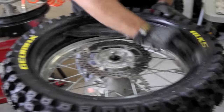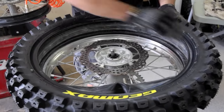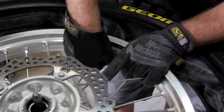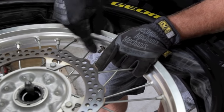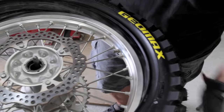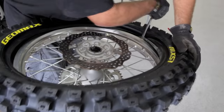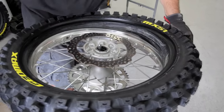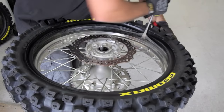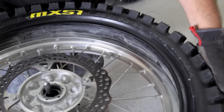We'll lube that thing really well all the way around. So we have our tube in here, now we're going to pull the tube through and keep the tire out of the way. I'm dialing the nut all the way down to about three quarters of the way. Now I'm going to feel underneath and push in here, make sure the tube is inside the tire of course. I got pressure against the tire, it's all the way on, keeping pressure with my hip against the tire. Grabbing right here with my hand also forcing down, taking a little bit of pressure off from the backside as I lift up to push in. Here's the rimlock — I want to get right on the other side of it. Now this last one you kind of got to push in there. Now I'm in all the way, so the rimlock's not on — that's the tricky part and we're going to flip it over to show you what to do.